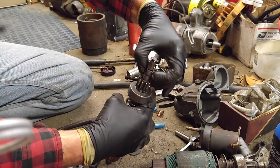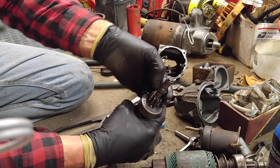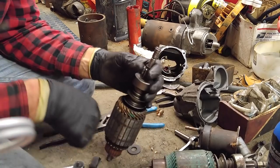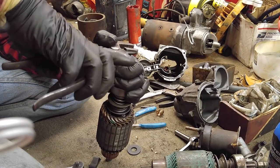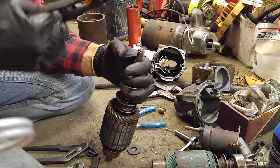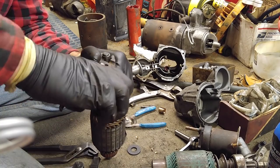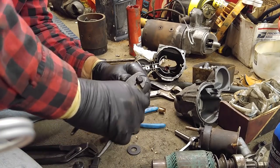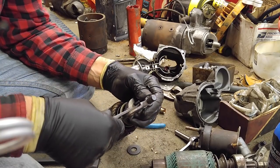Now what you do is you put this big ring on, and this big ring has a retaining ridge inside, a retaining receptacle for the snap ring, similar to what GM puts on their steering columns pre-airbag to stop the steering wheel from coming off. Or it holds the horn ring in place. It holds the lock ring, which is on top of the horn ring. So I'm going to try. This is the easy part, getting it on. The hard part is snapping it inside here.